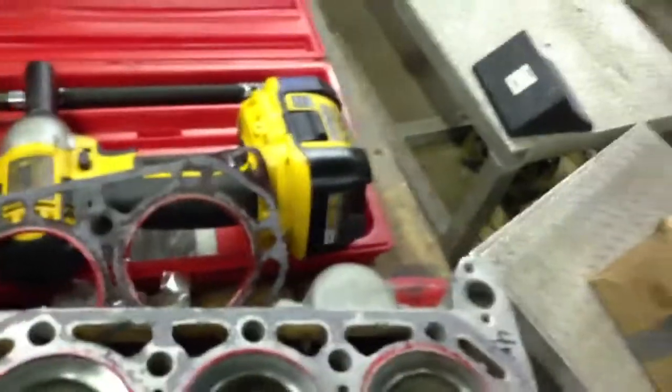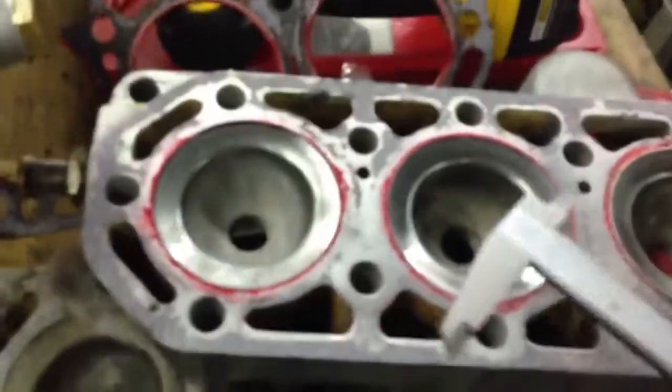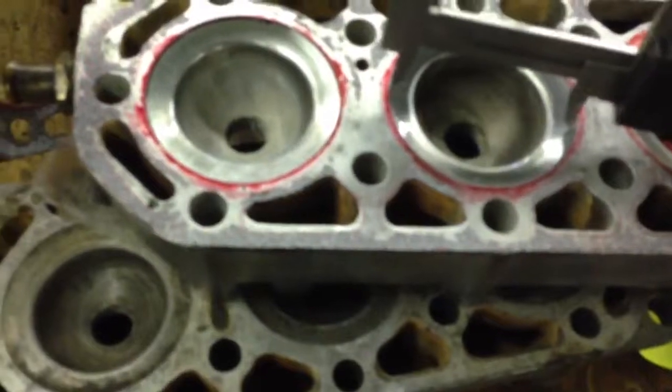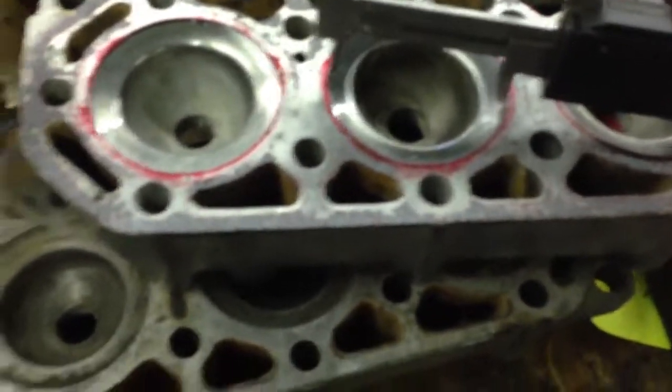Factory spec, from what I can tell, you have to have about .2 millimeter clearance more. So if I'm running a 71.5 piston, I want to be at least 71.7 in my relief area — sideways here in this area that is relieved for the piston to come up in. That's a .2 millimeter difference of how that should be. That's what's going on with this little girl — the piston's been banging on the side there.